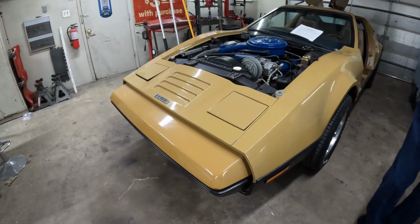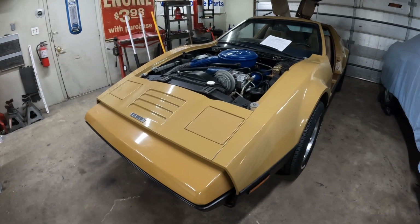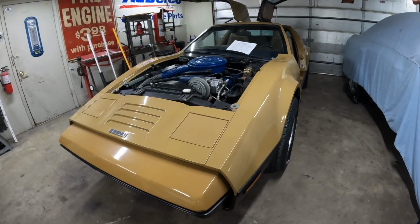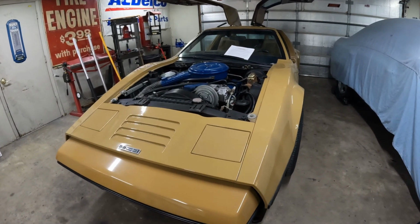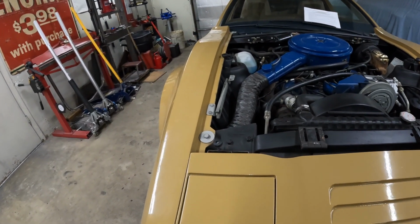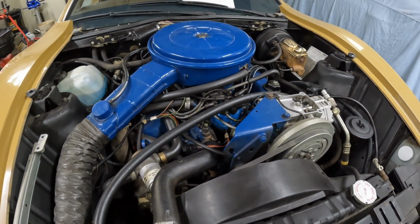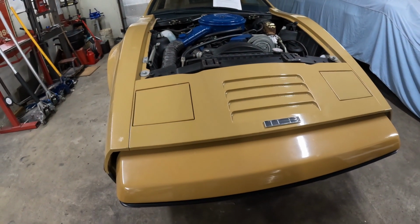We also make headlight relay systems, so you can have 20% brighter headlights and actually see where you're going. It's not those yellow '70s lights. You can upgrade to halogen without burning up the headlight switch and making the circuit breaker blink. The high fan relay: these cars burned up fan switches. It was an AMC fan switch, and AMC, Ford, and Chrysler all burned up fan switches. The high fan relay was only put on General Motors cars, but it burned up the fuse they use to keep you from burning up the switch. So we use a circuit breaker and a similar setup, and it makes the fan about 20% faster, getting rid of the voltage drop.